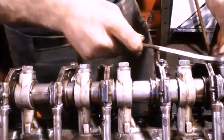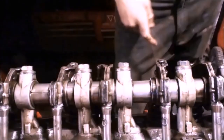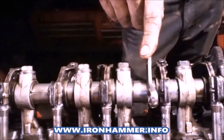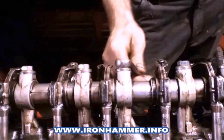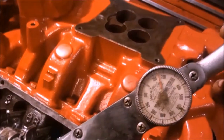Just keep giving little turns until you feel them all snug in. We also have a dab of oil underneath the washer heads. You'll notice sometimes I like to go to the higher end of the torque spec because those are old bolts, already stretched. These are new bolts, so we're going to go near the bottom of the torque spec. We'll start them all at 150 inch-pounds — about 12 foot-pounds — from center out, stepping up to 180, 196 max.